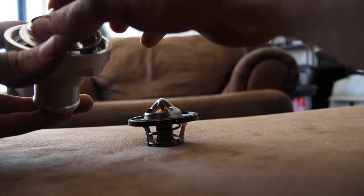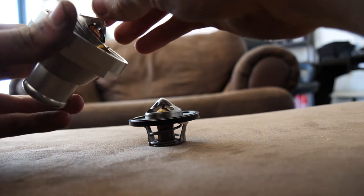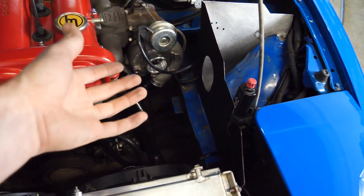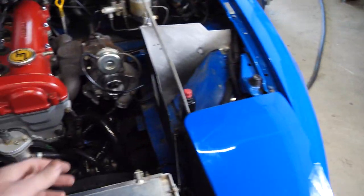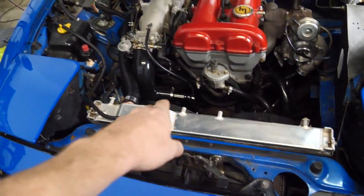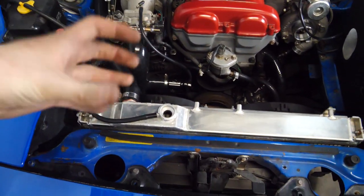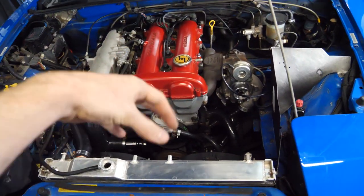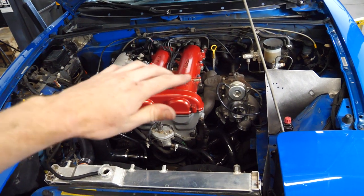Pop! I went ahead and put the airbox back in so I can make this new intake. It's literally just gonna be a 90 degree bend with two cuts at it. I also rewired the fans so both of them actually work. Put that back together. And you put this tray back on, tighten those lower hoses. Then we're gonna start it, we're gonna bleed the coolant system and have that all good.